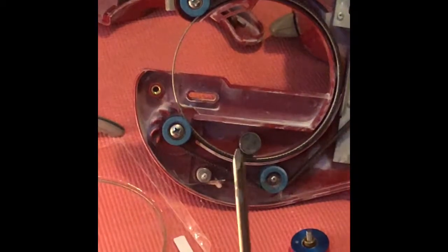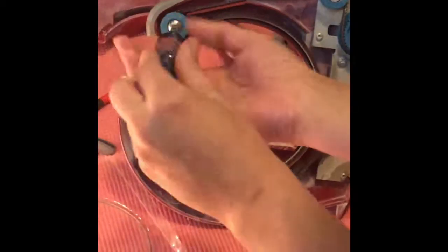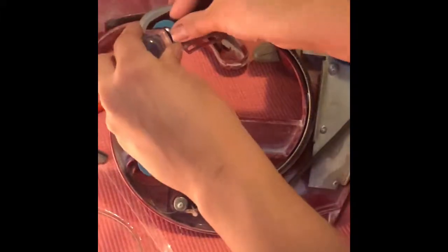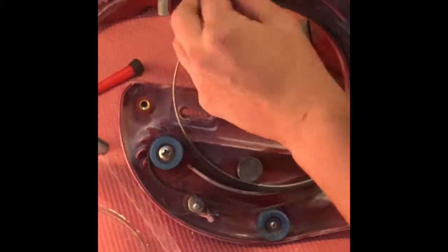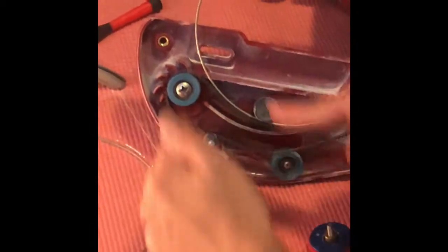From here, you're going to take a bigger screwdriver. To unscrew all those smaller ones, I use a small screwdriver. The bigger one is going to take care of this pulley here. Please keep in mind while watching this video, I'm a complete amateur just teaching my knowledge to you guys — what I've learned, I'm teaching as well. Down here, this is a spring-loaded pulley, so I'm going to loosen that. That's going to loosen the rest of the belt everywhere else. This is coming out fairly easy now that it's loose. Setting this right here — don't get any of these mixed up, keeping them right as I pull them out, remembering where they go.